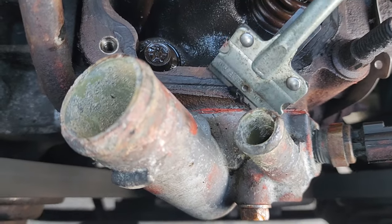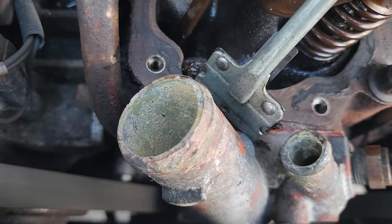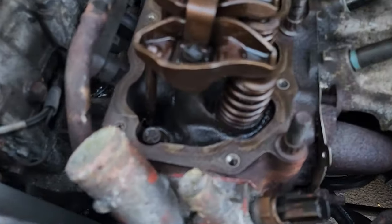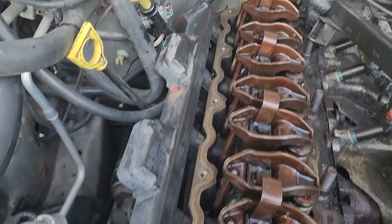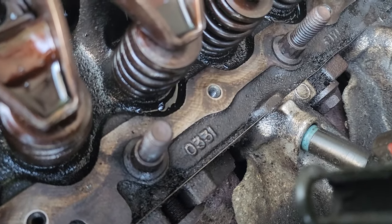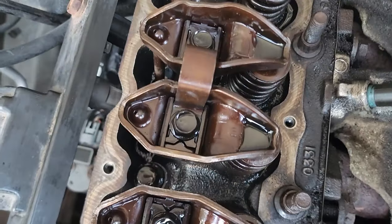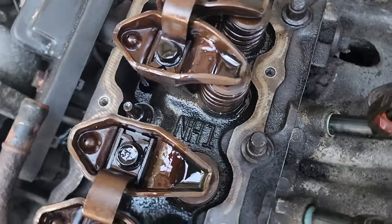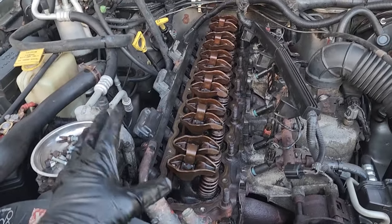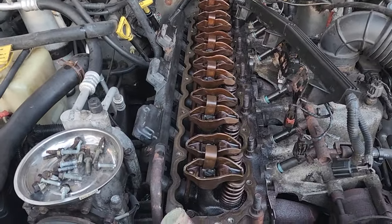After the schmoo has been cleaned up you could go full Dan H and scrape off all of this residue from the previous gasket - when this is off you're going to get a much better seal. Hey, check it out guys - I think I out-Dan-H'd myself. I went after this whole room with the wire wheel, it came out really nice. Even got in here and I cleaned up the casting number - oh look at that, 0331. The notorious XJ head. This is a straight-up 0331, the worst head ever made, so this should be a ticking time bomb. It's 200,000 miles and it's still going strong. Hopefully we won't have to replace this head, but hey, if we do it'll be another Dan H video.